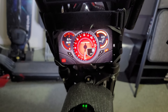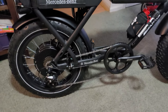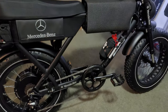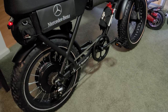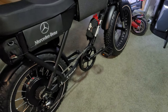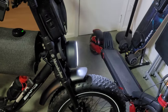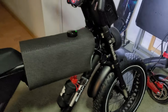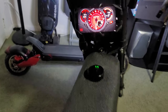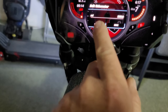That is a hub motor — direct drive — and it is so much better for me. I love the quietness, I love the top end, and I love the regenerative braking system. That's something you can't do with a geared motor.